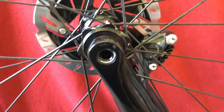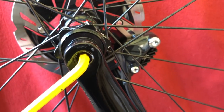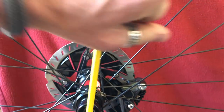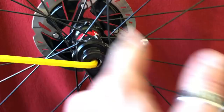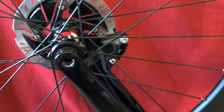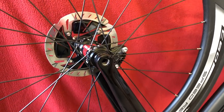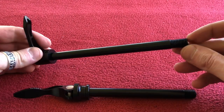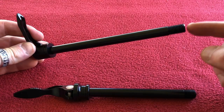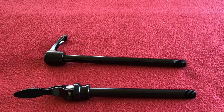Okay, so we're back. Whereas you would normally undo the through axle from the other side, this one you undo through the frame side. It's tightened to 10 Nm. So let's just spin that round until it gets bored — and yep, it's out. So I'll take them out and then we'll weigh them, measure them against the Yoleos. Okay, everyone welcome back. First, Yoleo-supplied through axles. You'll notice the bolt is missing on the nut and that's because I'm using it with the ones that I bought from Germany. Quick measure up, quick recap.